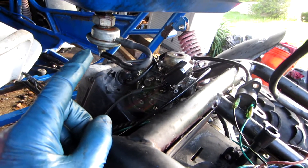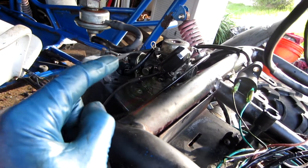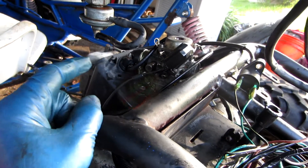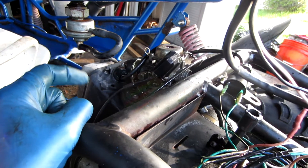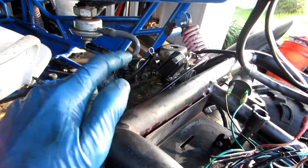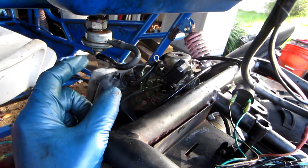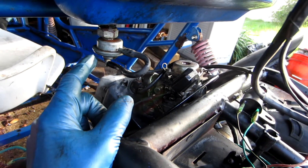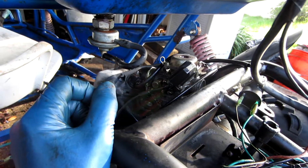The way this works is it's got a regular fuel line, but then it's also got a vacuum line which goes to the intake manifold. Inside of it is a little vacuum diaphragm which operates a valve that controls the fuel flow. So when the engine's running and providing vacuum to the diaphragm, it opens the valve and allows the fuel to flow. And when the engine is stopped and there's no vacuum, the valve closes and fuel is no longer allowed to flow.